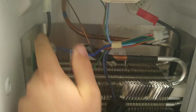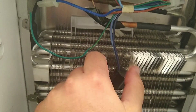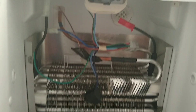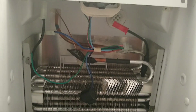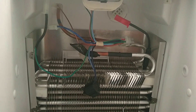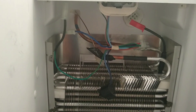Once the heater shuts off, the evaporator will freeze back up and the thermostat will close again. Your defrost timer, or if you have a defrost system through a control board, has a time limit on it — some are 8 or 12 hours. I'll go back and explain that in the next video.